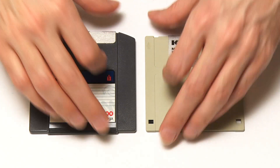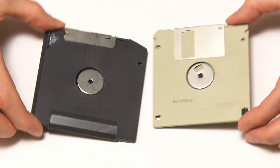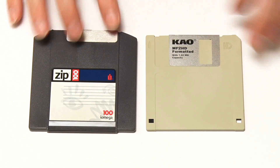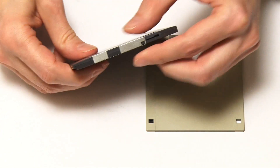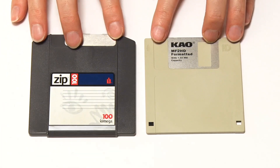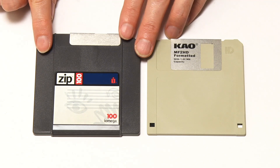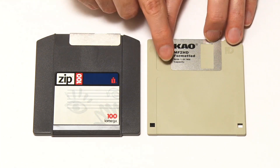The technology here is pretty much the same — if you flip these things over, you'll see they both on the back have a spindle mechanism to engage their single internal flexible magnetic disk. The real difference in form factor is the floppy is a lot thinner than the Zip Drive. How did it achieve 70 times more capacity based on the same technology? It had a much higher density, much higher quality magnetic coating on the disk inside the Zip Drive. That enabled a much smaller drive head, more tracks on the disk itself, and a much better head positioning mechanism. They basically optimized everything from floppy to make the Zip Drive work.